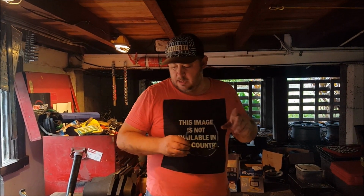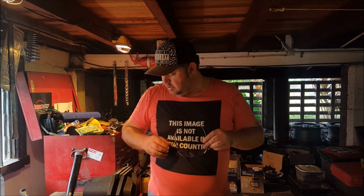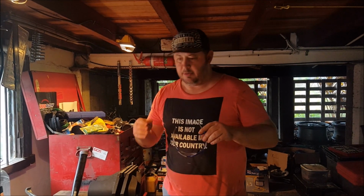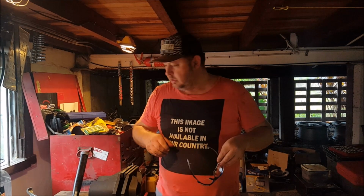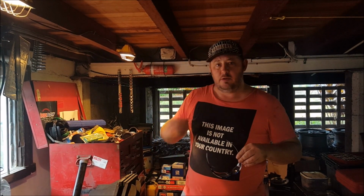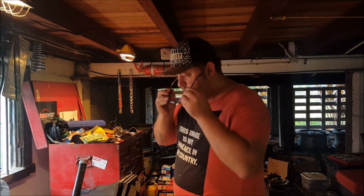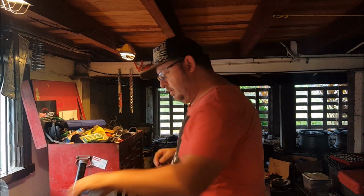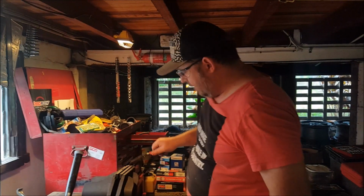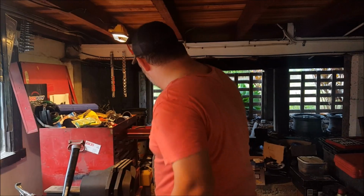So to get these out, what I'm going to do is, this is a short extension. Now that I've established that's not spinning on that, it's the teeth of the vice grips breaking off. I'm going to cut the end off this and I'm going to thread it and wind some nuts onto it, and then use that to try and get enough force on there with a ratchet. So cut the square end off, tap this end. I don't know what size I'll tap it, whatever it takes.